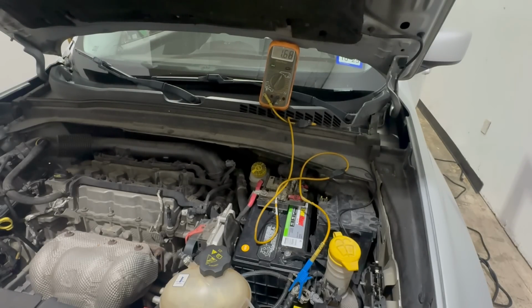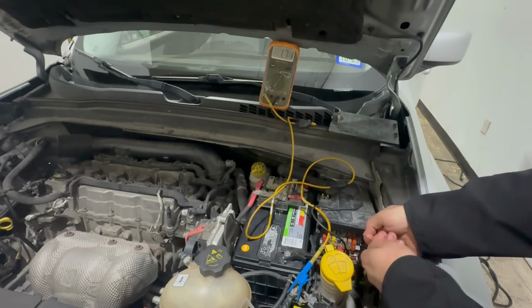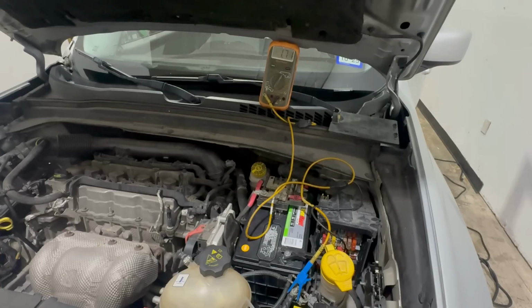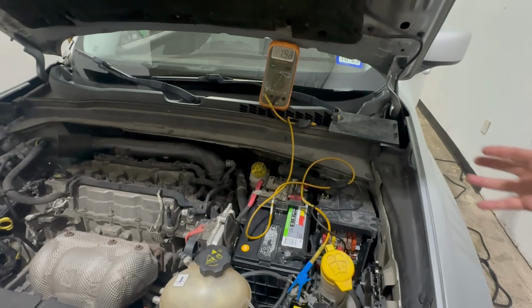It's just when I was doing my prelim checks and I started seeing that this is like that. Imagine trying to stick your leads in there to do a voltage drop test between the fuses. That's going to be really hard. And especially the one inside too, we couldn't even see how that looked. So that's where I'm going to do it this way. We're going to see how it goes. If we start seeing differences right here where we remove a fuse and it bumps up to 4 amps or something like that, I'll do it a different way. But normally whenever I start a parasitic draw test, I'm pulling fuses. I'm sorry if it offends anyone, but that's the way I do it. I'm a little bit old school.